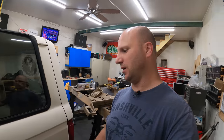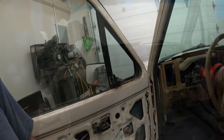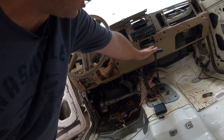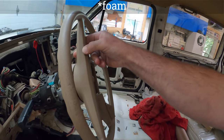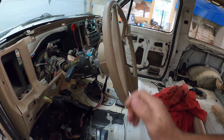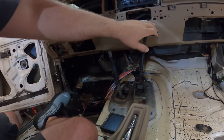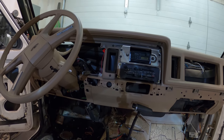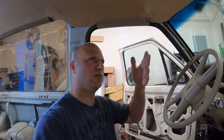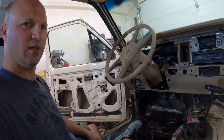The Bronco is back in the shop and I'm kind of running out of room. I think my best course of action is to get at least some of this interior back in the Bronco — at least the dash. Quick update: I taped off the majority of the dash and painted the lower half, basically the bottom third. Had to paint the side of the dash, the steering column collar, and steering wheel itself — it's a fairly rubber steering wheel so I'm not holding my breath that the vinyl paint sticks perfectly. Hey look — the dash is back in and it looks great. The paint blends and matches very well considering it's smooth metal to textured plastic.